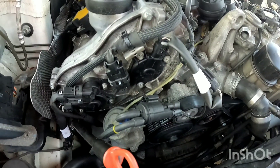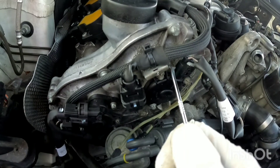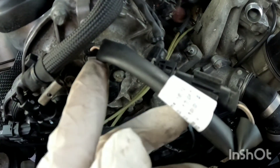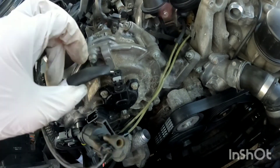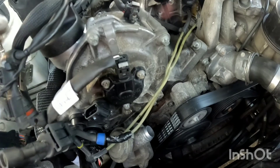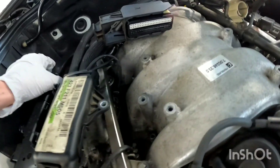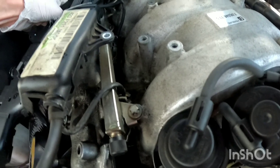To give yourself a little more space with the wiring harness, we're going to take this little bracket off and unplug this wire and this other wire. I had trouble getting one of them out, but you really don't need to remove it because the wiring harness has plenty of space to move after you do the others. The rest of it is really just disconnecting your fuel injectors.